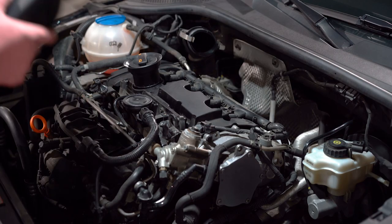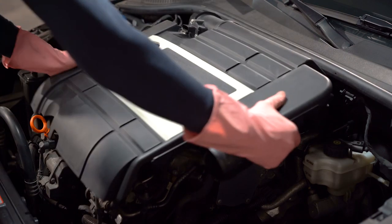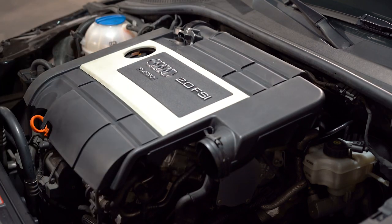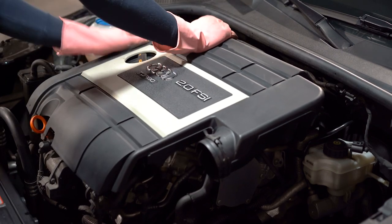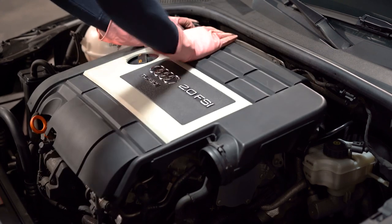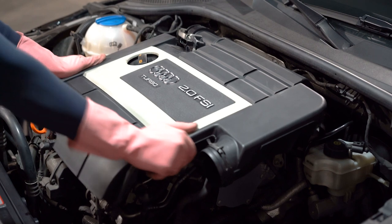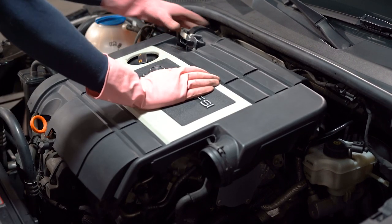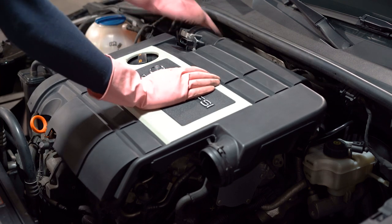And that's basically it. All that's left is to get the engine cover back in. As you already saw in the previous videos, it's just the procedure in reverse order — get the cover back in, connect the two intake hoses (one with a clamp and the other with two silver ones), and connect the mass airflow sensor connector back. And that's it — you've replaced your cam follower.